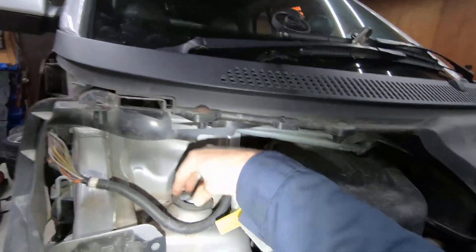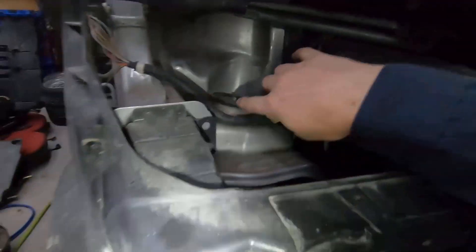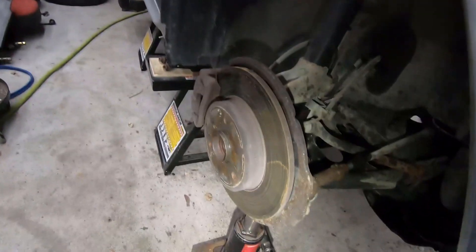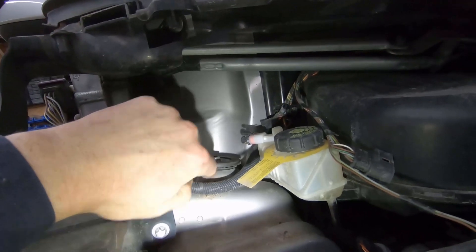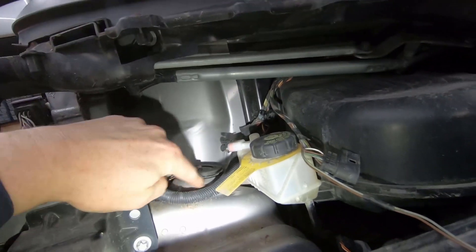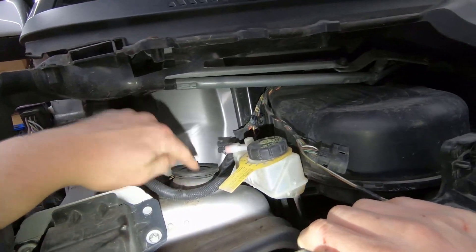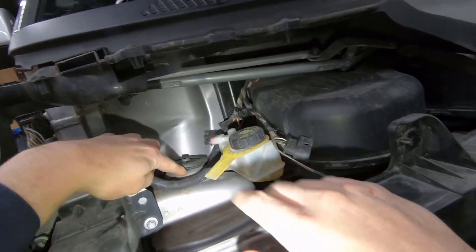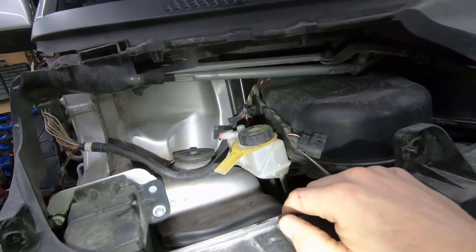What I came up with was by looking at this little flange or retaining cup at the top - you can see it's tight to the bodywork right now with the wheel fully extended and no pressure pushing up. As I raise it with the bottle jack, you can see a gap opening up between that little cup and the bodywork. This gap tells me the rubber bushing on the top of that strut is worn out. In normal driving with the car's weight on it, there's a gap, and when you hit a bump big enough that the wheel drops, it comes down and hits the bodywork - that's where the clunk is coming from.